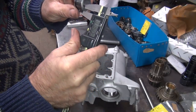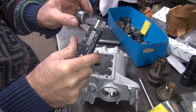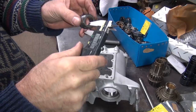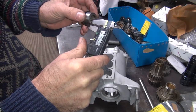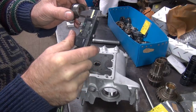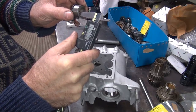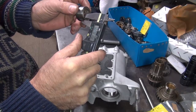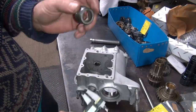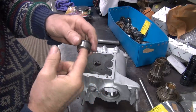Let's see if there's a concentricity issue. 180, 182, 183, 184 - 179, 189. That's got a lot of wear issues - not round, that's not good. Let's see if this one's any better. 180, 79, 180, 81 - same issues. 83, 84, 86 - holy crap, that's bad. This is brand new Harley American-made stuff and we don't buy crap around here - just because it is crap doesn't mean we do it on purpose. That is the problem with Eastern products - not as good as Taiwan a lot of times, maybe better than China, debatable.